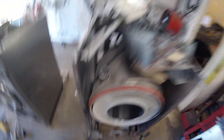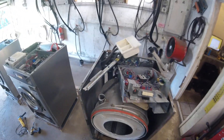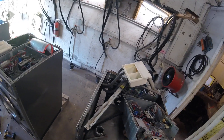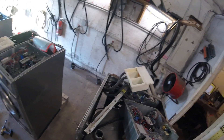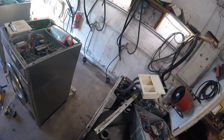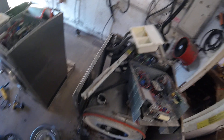Now you're gonna have the front plate still on with the locker — they put them together with this setup at the factory. By yourself, it is very short and very hard to put back together with these, so I'd just go ahead and cut it right off. If you have room to get the grinder in here, it's a lot easier to cut with that. If not, that's where you can get your reciprocating saw in — just cut it, it'll pop apart and you're done.